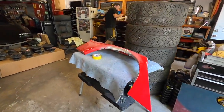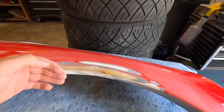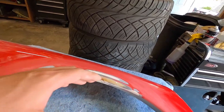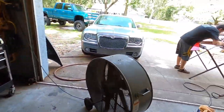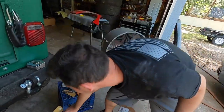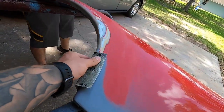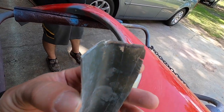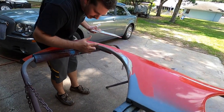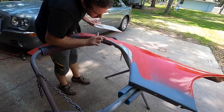And here's the other one — same deal. Built that all up through there. We used our little mold, laid in the glass, sanded it down, and Aaron was using his little mold — he's calling them the Viper molds now. This is his signature piece right here. He was literally just laying these in and it was making the perfect profile all through here. So he's going to put a little bit of mud in there — small stuff — and then a little bit of sanding and she should be ready for primer again.